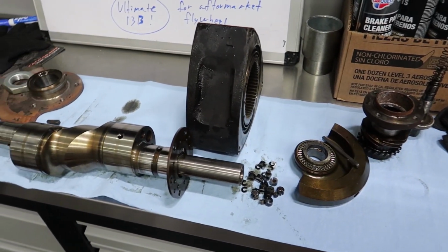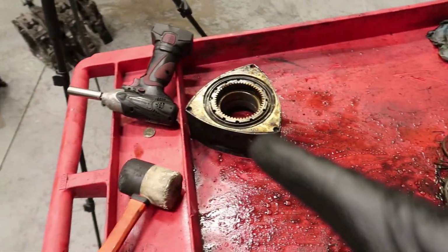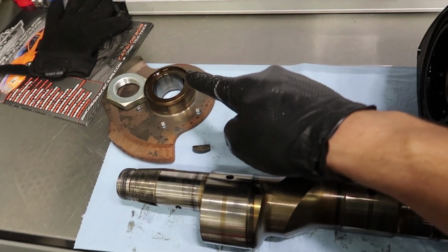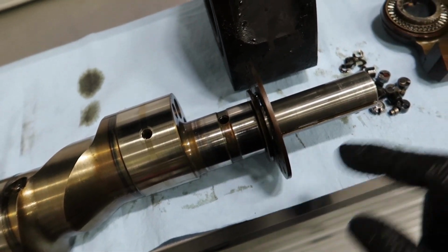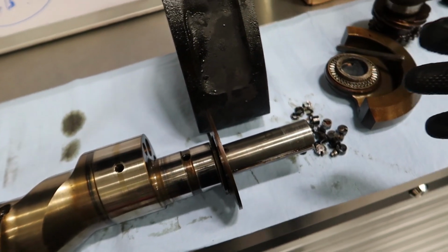I have the rotor parts here. So I have one rotor, this is the front one, the rear one still on the table. Then I have the eccentric shaft right here, rear counterweight, the rear keyway, front keyway. And there's one of the needle bearings already here. Then the other parts here that I'll put all together. It's kind of like holding it as one unit.